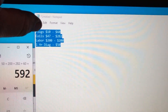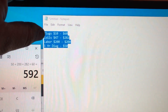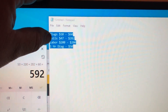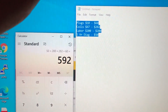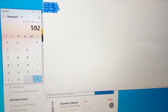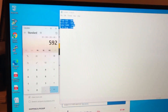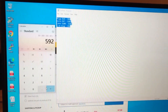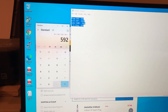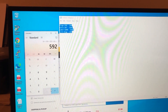Here's what it comes to: NGK iridium plugs are ten dollars apiece — I'd do iridium so they last as long as possible. Virginia Honda OEM coils are forty-seven dollars apiece. Labor is two hundred dollars plus a one-hour diagnostic. All together that comes to five hundred and ninety-two dollars for the repair. If it was a front coil we'd just swap it out quick, but since we're tearing it apart we might as well do them all. I also gave the option of doing just the three back ones for now. Anyway, that's what it is — this is Tommy Frugal Prepper.